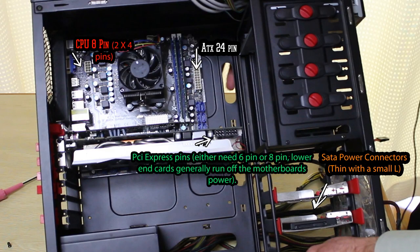I've pulled up a picture here for you guys because unfortunately my camera overheated and I didn't realize until right at the end. So this here is basically you've got the ATX 24-pin in white — that's a big power cable. It usually comes in a 20-plus-4-pin configuration. I just had enough cable length to run it through the back. If you don't have enough cable length, then don't be afraid to run it straight over the graphics card and straight into the board. That's the first thing you want to connect. When you connect these power cables, make sure the power's off. Up the top left in red is the CPU 8-pin, which usually comes in a 2x4 pin configuration. They'll go right next to each other and should slot straight in. I didn't have enough length to run this through the rear so I had to run this straight over the graphics card.